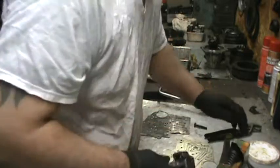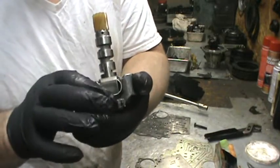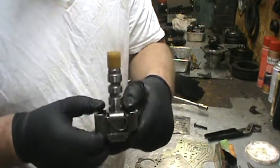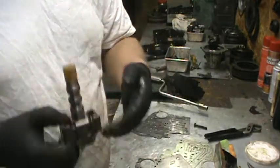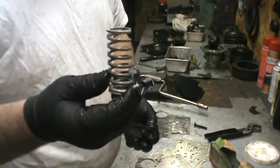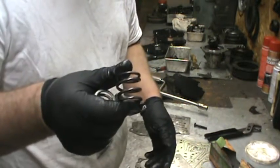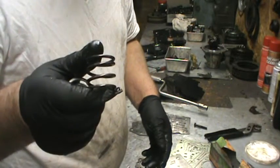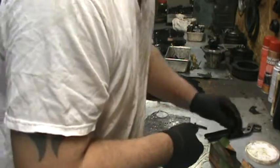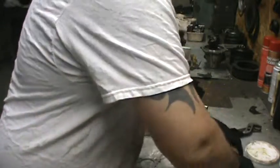The Transgo plate is actually two or three small plates glued together. Notice how thick that is compared to a factory plate — there's been a lot of engineering involved, and there are substantial differences in quality versus the cheaper plates. When you get a Transgo kit, they've modified a governor, and if you want to go full manual, you get a couple of clips to hold the governor open instead of having to modify the valve body. You also get a stiffer 1-2 accumulator spring for a crisper shift, a stiffer spring in the second gear servo band, and different direct clutch springs — though not trans brake springs, which are a lot longer.